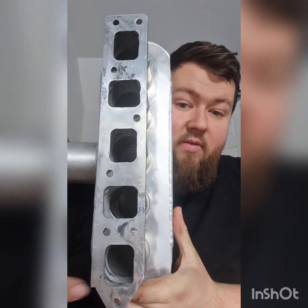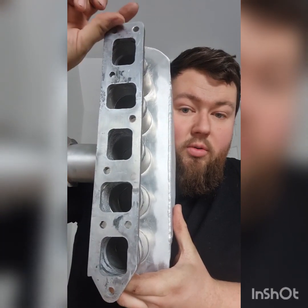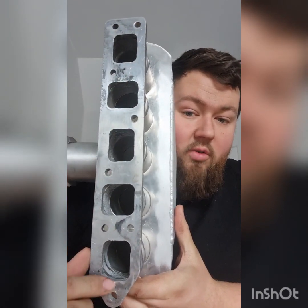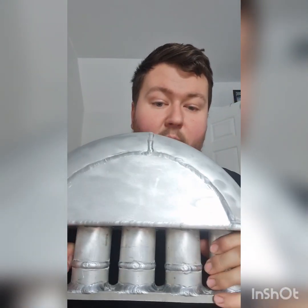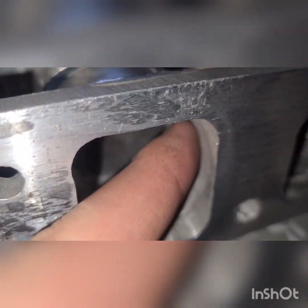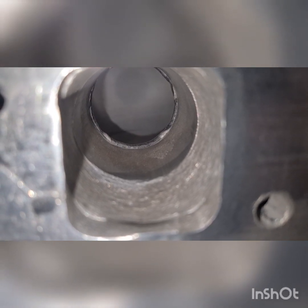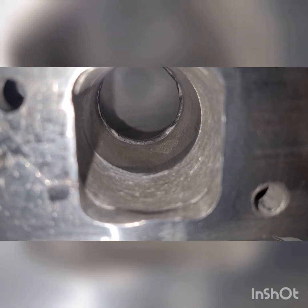How the port runs and works on a V5 is also exactly the same as a VR6 24-valve — if you were to literally take one of the ports away, they are identical. So you've got all of these here. Because this is a round pipe, I cut the flange quite thick — it is out of 10mm thick ally. As you can see on the port here, I've cut it short so that I could get a die grinder in on both sides and smooth this out as best as possible, then run it straight into the pipe, which goes into the main plenum. Inside the plenum it has been welded internally to create a smooth weld so it just runs straight into the pipe and then into the engine.